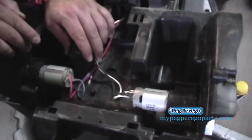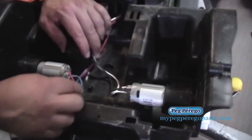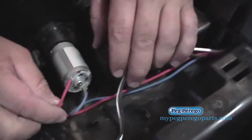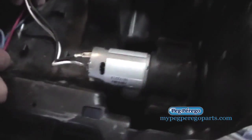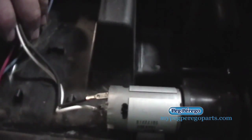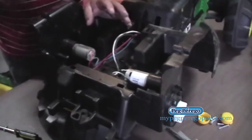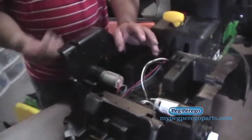You can make a note of where to put the wires, but the main thing is to make sure they're paired up: blue and red, white and black. On most of the models it's that way. If it's different on yours depending on what year and factory it came out of, go ahead and just make a note of it. Before you put it all back together, make sure it's spinning in the same direction — when you shift it into second or high, the wheel should be spinning fast and forward. If one side is spinning backwards and the other forwards, just switch the two wires.